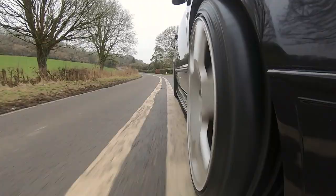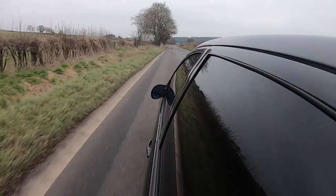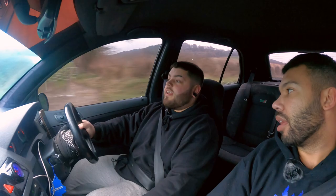The ride's not too bad actually. Is this on coilovers or lowering springs? It's on Pro Sport coilovers with polybush everything. You can definitely feel it — everything feels really firm, not uncomfortable, just really taut and very responsive. It's also got polybush engine mounts, which I'm not a fan of — when you're sitting in traffic everything rattles around — but it does stop the front-wheel-drive wheel hop. I've got a Revo dog bone mount in my car for the same reason.